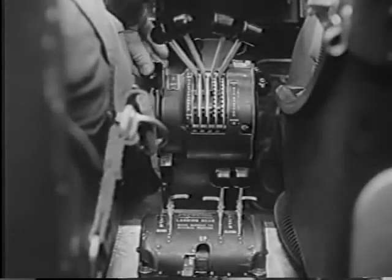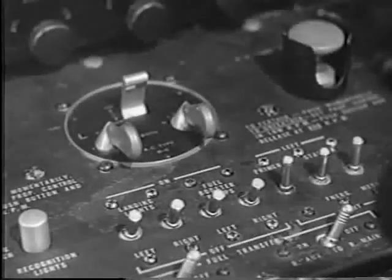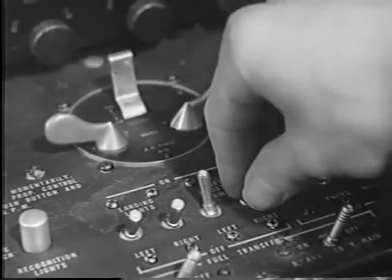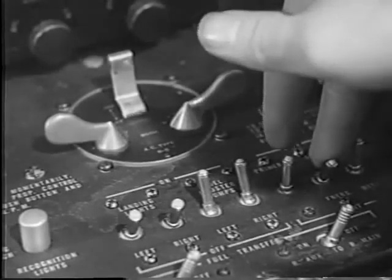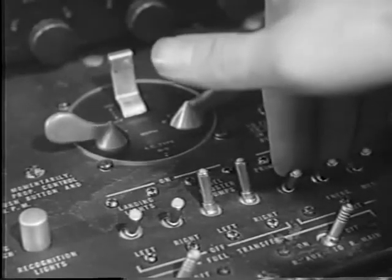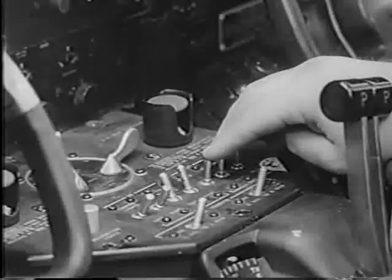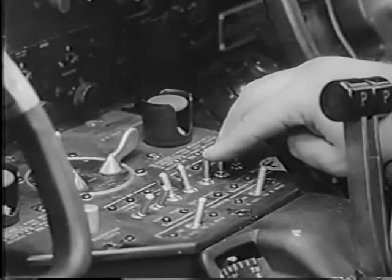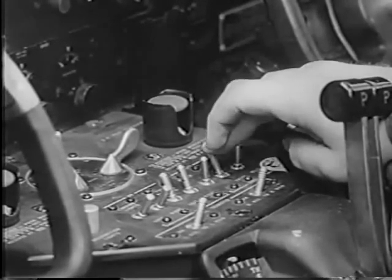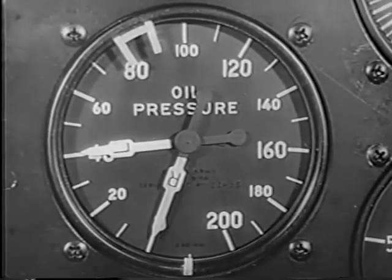Now start a methodical tour of your instruments. First, turn on the fuel emergency shutoff valves, then the generator and active inverter switches. Open cowl flaps. Close oil shutters. Move mixture control into full-rich position. Open your throttles one-half inch to give about 1,000 RPM, and lock the automatic pilot off. Turn on battery disconnect switches. Next, switch on your ignition and fuel booster pumps. A good pilot always starts his right engine first. Energize the starter, then prime five to seven shots at one second each if the engine is cold, or one to three shots if the engine is hot.